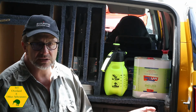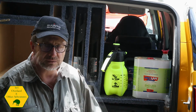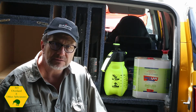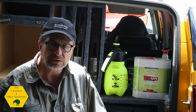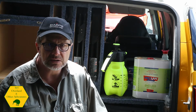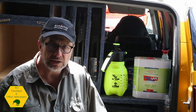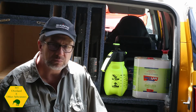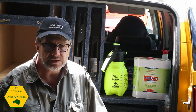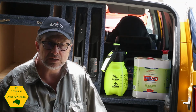The only issue is that while you're using it, you get dirty. So if you've got an overall, wear an overall, but you do get fairly covered. Ideally you would have a lift like you've got in the service station, where you put your car on the lift and it lifts your car and you work underneath. Not many of us have got those, so what I did, I got 4 planks of wood which are thick. They're probably 2-3 centimeters thick. I put 3 or 4 under each wheel and I reversed onto them, so I lifted the car probably 15 centimeters, but all 4 wheels were on. It was quite safe, and that's what I did.